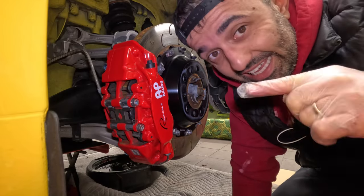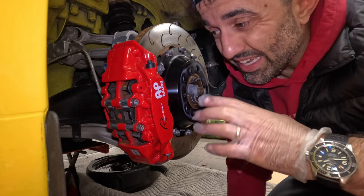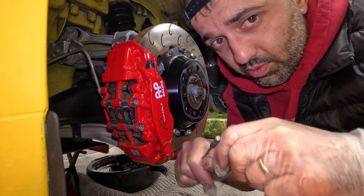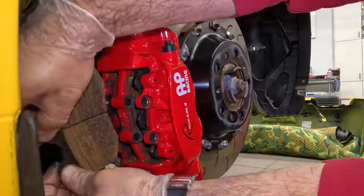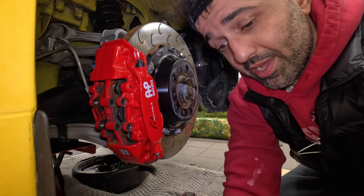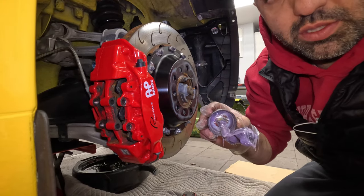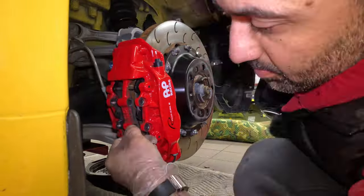As we're waiting for the oil to drain, we're going to swap out the pads on this AP Racing kit, which I got from Keys Motorsports — link in the description. It's a fantastic brake kit and super easy to swap pads: you've got two allen bolts, then knock out the two pins, and you should be good to go. Out with the old DS 2500s, in with the new DS 1.11 track pads. To prevent squealing, we're going to apply Schmear to the back surface of the pads as well as the corners. It took me about 20 minutes to do all four.